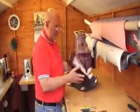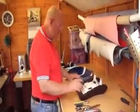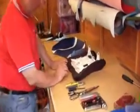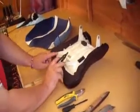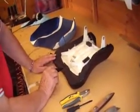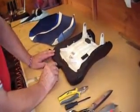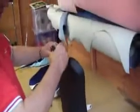Okay. First thing you need to do is find the centre of the seat, because you need to keep your cover on central when you do it. You can measure it, or you can do it by eye. I tend to do it by eye, but again, I've done quite a few. Just look at the centre. There's 2 marks in between, so centralise that. Again, you can see those 2 holes, so you know that's central through the whole seat. So put a felt tip pen mark on there. I do tend to transfer it just across the back a bit in case I lose it.